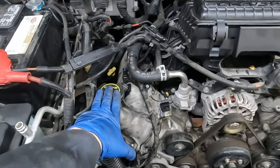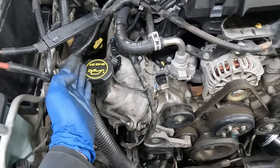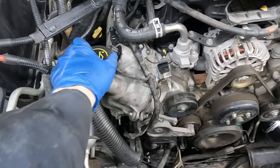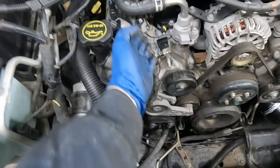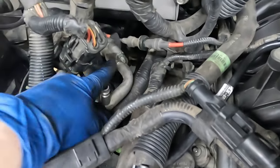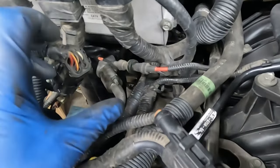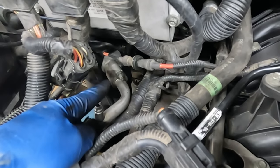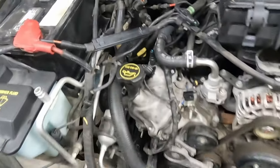This harness goes on this side of the filler, not on the other side. You can take the filler cap off and it'll just barely squeeze over the neck to get it on. For the AC: put this line on first before putting the back one on, because you'll need this to move around to get the other one back on. Do this one first before the back - I did the back first and regretted it.